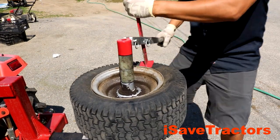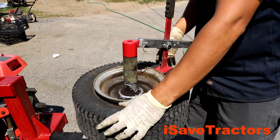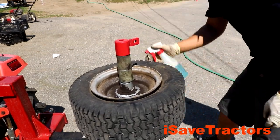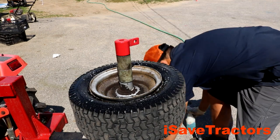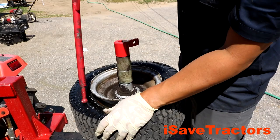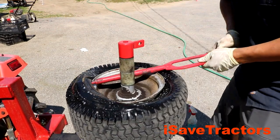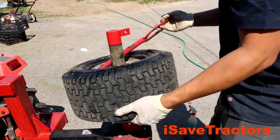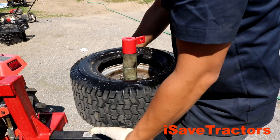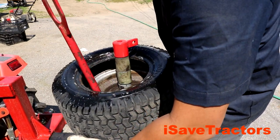After I push this bead down off of this tire, I then prepare to remove the tire off the wheel rim. I do this by spraying the tire with a mixture of water and dish detergent — it helps make the tire nice and slippery. Then I use this other tool that's included with the tire changer. I stick it inside between the tire and the rim and, as you can see, it just pushes the tire right off the wheel. I repeat it for the other side of the bead and it comes right out.